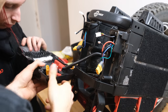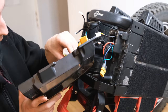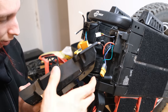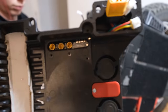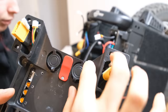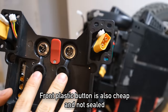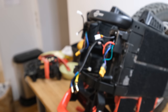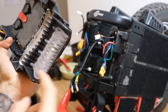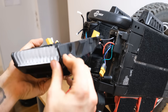Although the motor phase wires are on the bottom of the control board — meaning they're not so susceptible to rain — they should be isolated. This plastic cover was all that was between the control board and the elements. The hole in the front was tight but there was no rubber seal, no silicone. This needs to be improved, because if the wheel falls into water or there's a puddle, it could be a disaster. The semi-transparent piece in the back is there to disperse the light from the diodes on the motherboard.